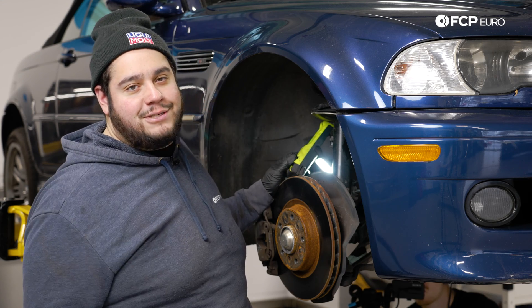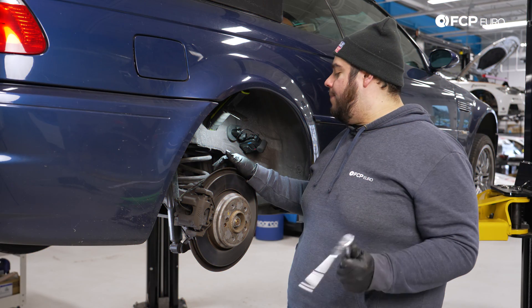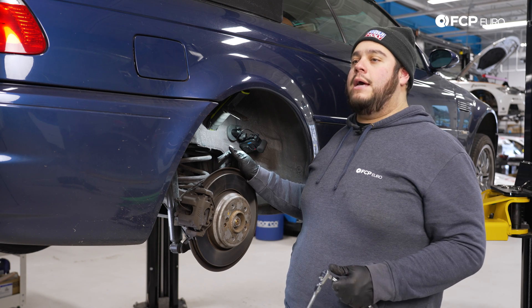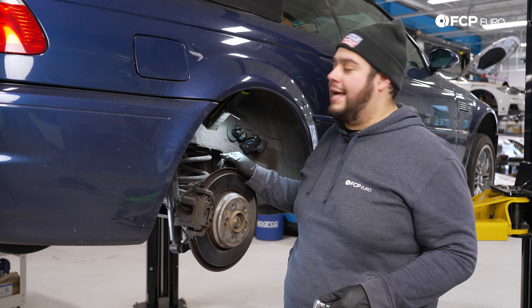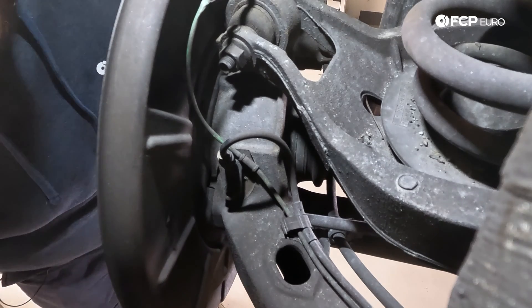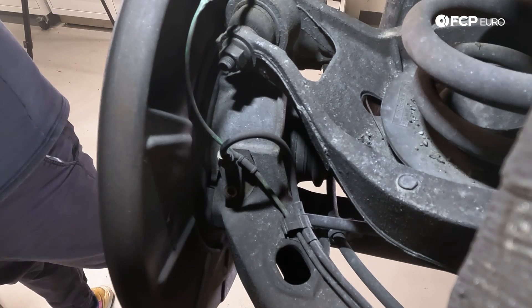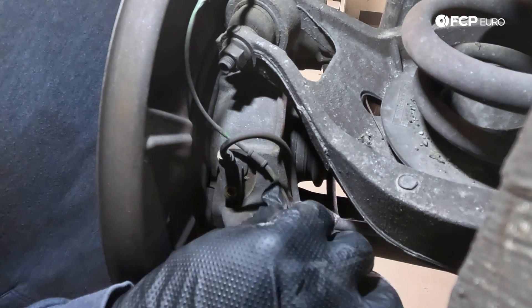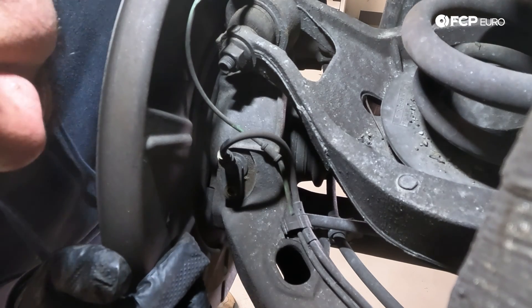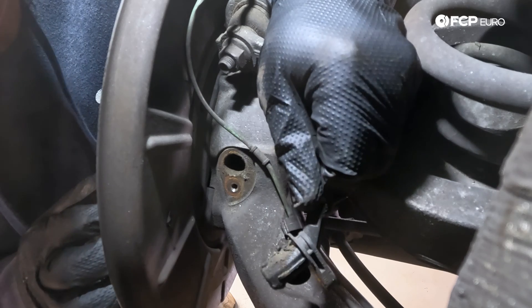We'll get one of the rear wheels off and show you how to tackle those as well. The rear sensors are going to be a little bit trickier — there's going to be some snaking in between control arms, but nothing you can't handle. In the back we have the wheel off already. We're going to do the rear passenger sensor, and these are going to be identical for both driver's side and passenger side. Starting up here with the sensor, we have our five millimeter hex ready. Grab the five mil hex with the extension, get it situated all the way in. Because this car is the coupe, sometimes these harnesses will run through the control arm — just be mindful. Otherwise they're pretty much identical; the routing is the only thing that really changes across the models. This one came out a lot easier without a fight. Make sure to clean that opening where it sits — you can see how contaminated and covered in grime this sensor is.